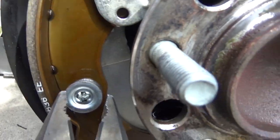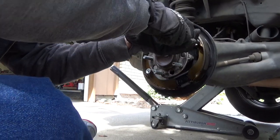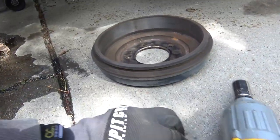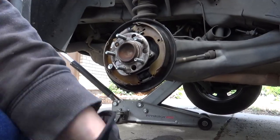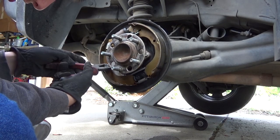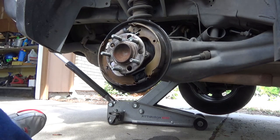These springs have a locator pin on them — you've got to push them in and twist them. I'll literally just push in and twist like so. It pops out — pops through the back. What I do is just take it out, this little pin, and set it oriented the way it came out of the car. There's a tool for this, but I don't really care because this is free and it's easy. Just got to make sure you get a good grip on it and pull it off. Make sure you don't damage them because they can be damaged pretty easily.